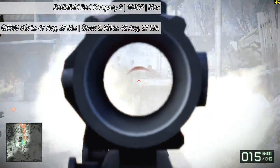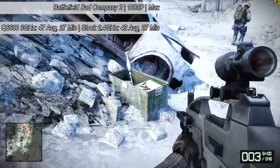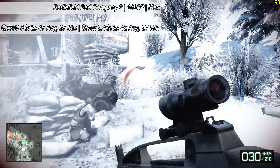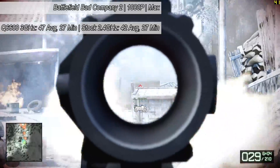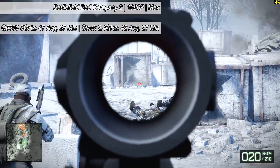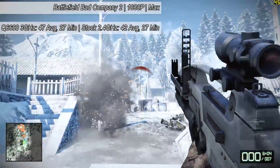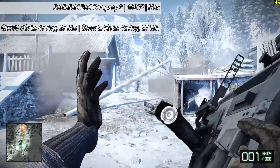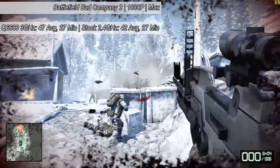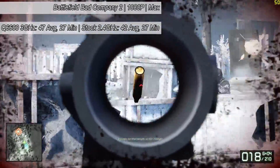There we have it. If you have an old OEM system with limited BIOS functions and don't think you can overclock, you may be surprised as to what's achievable. I'm still a big fan of old Optiplexes and 775 quad cores, so a little trick like this may come in very handy. Don't forget that this can easily be reversed too — just take the tape off. As for temperatures, there was actually a drop at idle of 5 to 7 degrees, but under load I saw an increase of between 5 and 10, and the system was incredibly stable throughout. You wouldn't even know that the tape was on there.